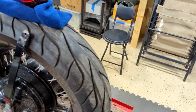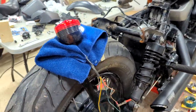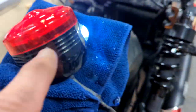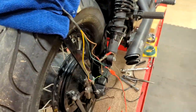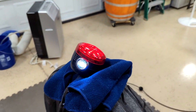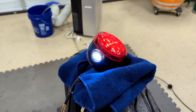Let's go over here and turn the on switch — looky there! Now we're getting where we're supposed to be. I said in the other video we were going to use an ohmmeter, but I decided to just jump right into it. We've got a taillight, a running light, and our tag light which is on all the time — good news. Now let me try to hold the camera on the taillight assembly and hit the brake. I'm hitting the brake now — got brighter.